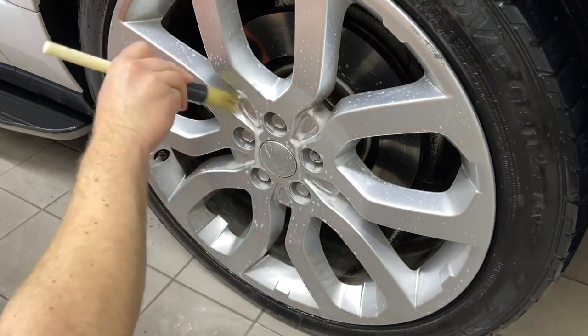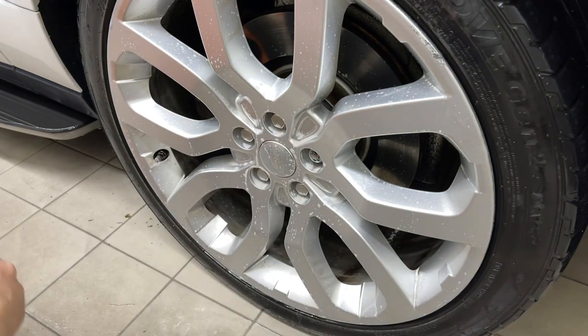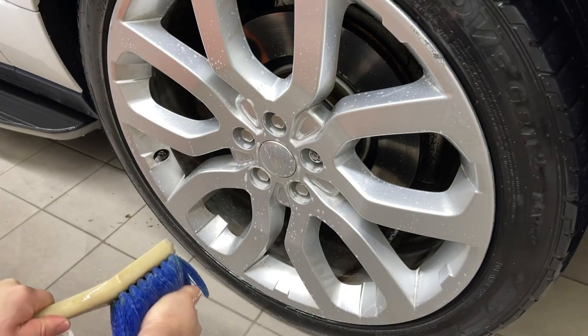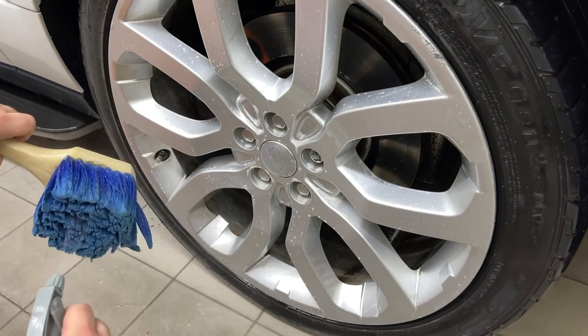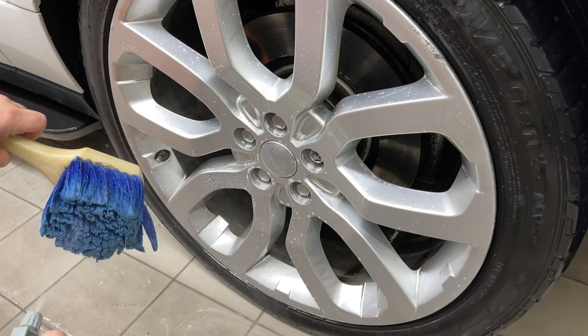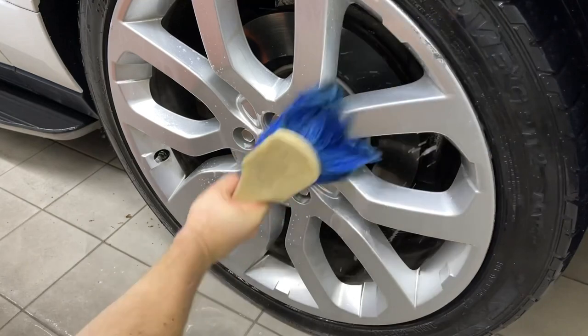Like bare aluminum or polished aluminum — acid will destroy them, and you'll be repolishing them afterwards. Obviously, don't do that. Wear safety glasses and, depending on how much strength you need to mix it to, you might want to wear a respirator because they are quite pungent and really sting.